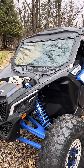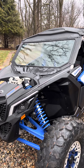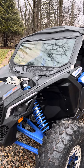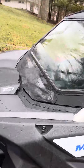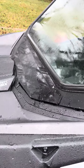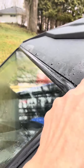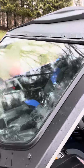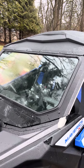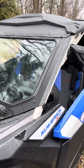It's a decent windshield — it's glass, it's got a nice rubber seal, aluminum frame with flanged support along the top so it doesn't sag. It's got this bottom piece across the bottom that comes out with three 5mm screws and tap holes in the windshield for those. Then you've got five or six bolts across the top — I'm using M5 in the middle and M8 on the outside because those go to the brackets.